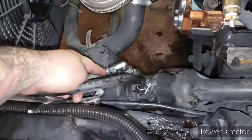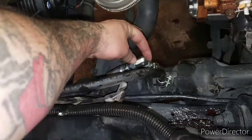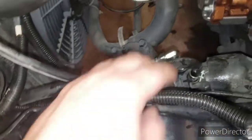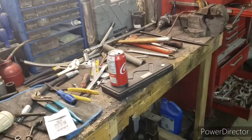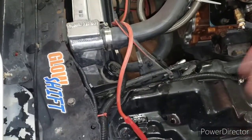I had to make the hose with dash 6AN fittings. I bought these elbows from ICT as well and they screwed right onto those fittings. The return hose is just a transmission oil cooler capable hose, because I was trying to use some braided stuff to make it look fancy, but it started chewing away at the coating on it, so that's no good. Had to get a transmission fluid capable hose — and that's all I did there.